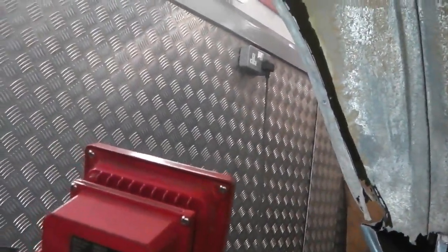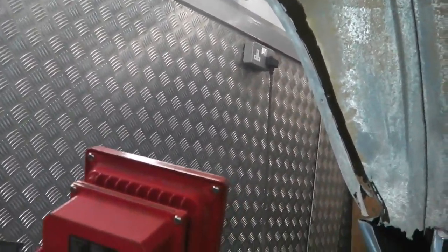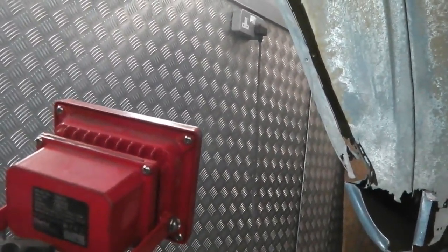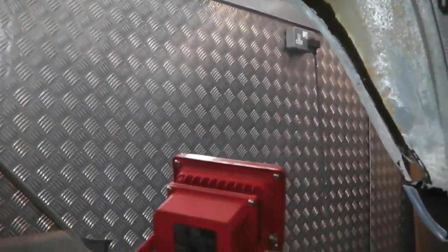There's some holes there, you see, for the chrome wheel arch trim. They're not the MIG weld, so it's trying to spot where they've MIG'd it, really. It looks like I can see it. The clue is they've burned into the edge of the wheel housing lip, like this one. That's your clue. Mysterious bit of lip missing means someone's been MIGging the edge. They've just MIG'd it on at the edge. That's how they fitted that.